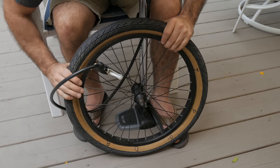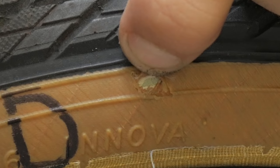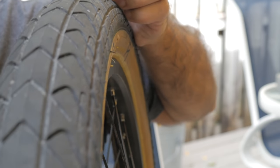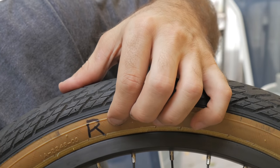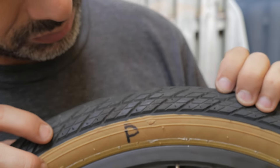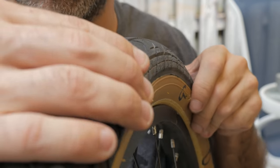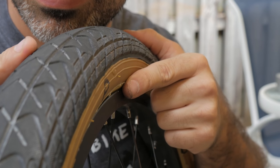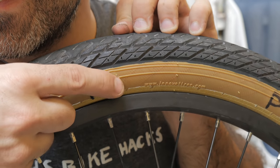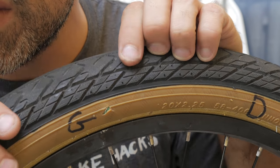Now for a little pressure. Let's do 30 psi and take a look at our repairs. We can see the dollar bill is firmly in place, and although the tear can flap open freely, there's no bulging or signs of stress on the sidewall. The tire boot is holding up quite well, as I would expect. So is the patch, although there are some signs of stress on the sidewall — maybe that's because the patch is rubbery and allowed to stretch. Then we have the tape, which looks pretty good, and the glueless patch which looks like it's ready to blow.